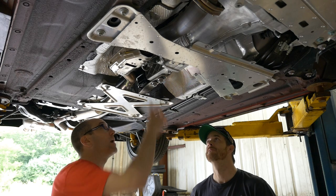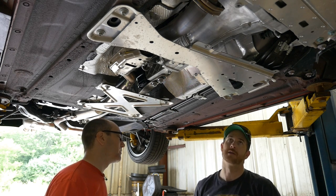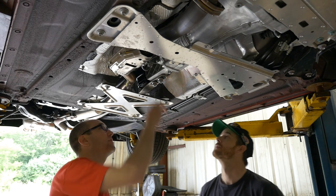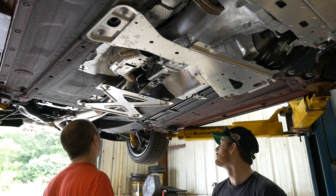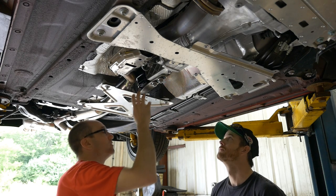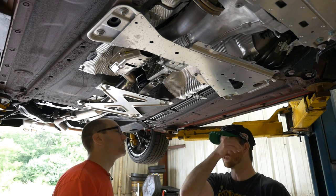And they've been doing this for a while, but it's slightly improved on this. Yeah, it's nothing new. Camaros had that, and I'm sure countless other cars have done it too. But they found a way here to lighten it. Mm-hmm. This is a really light structural beam with holes all along the aluminum to cut weight but keep rigidity. I think the aluminum's half as much as the other one was.